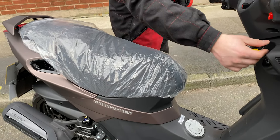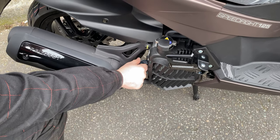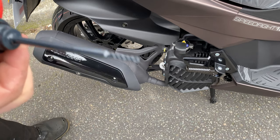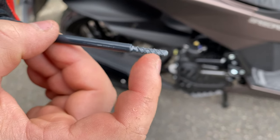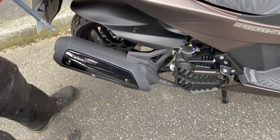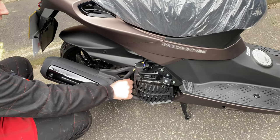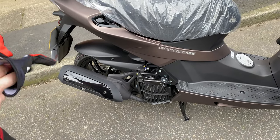Your oil is on the right-hand side of the bike. To check it, unscrew the dipstick. You'll notice there are hatchings — the low mark and the high mark. You want to make sure there's always oil showing. The bike has to be on level ground with a cool engine — leave it for about half an hour after running. Dip it in, pull it out, and as you can see there's oil on there. Make sure you always tighten it so it doesn't come loose. Thanks for watching — if you've got any questions just give us a ring or message us on Facebook.